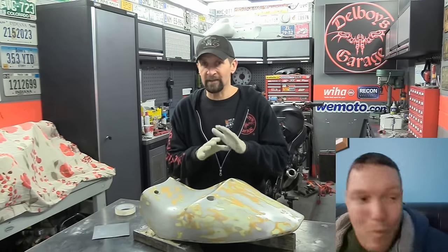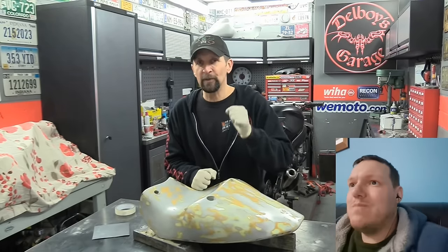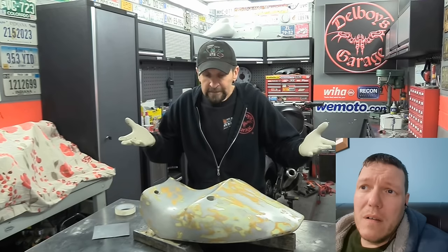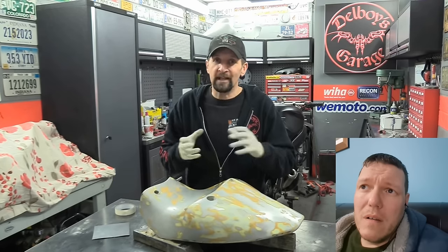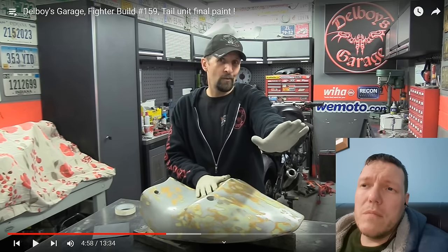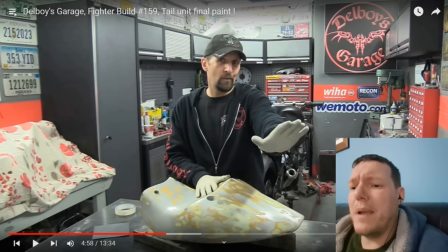But it works. 1,000 grit is absolutely fine. And think just for a minute. When you do clear lacquer over artwork, you haven't keyed that up before you spray it, have you? That goes straight over the flat bodywork with no key whatsoever. And it works absolutely well. So, however, it works. As long as it works, that's why I'm going to do it. I'm not going to say this is advice or guidance. Don't do it. But the fact of the matter is there's a time and a period when you spray the paint...